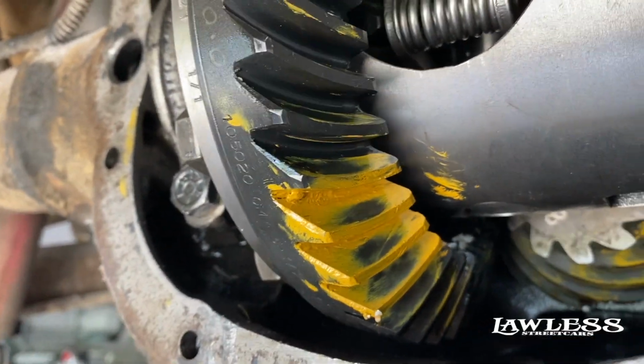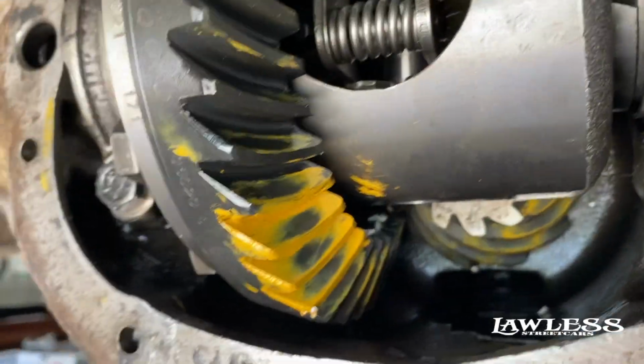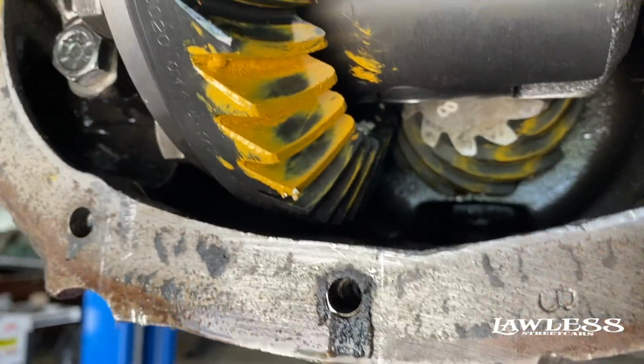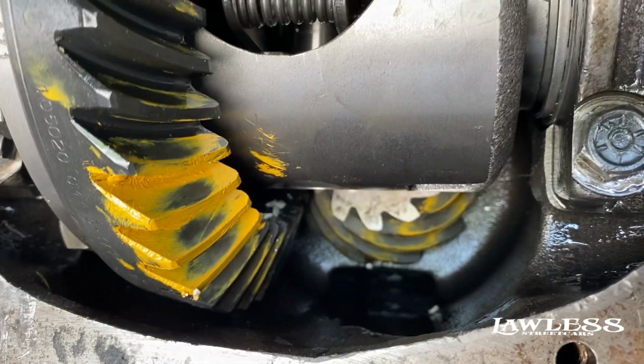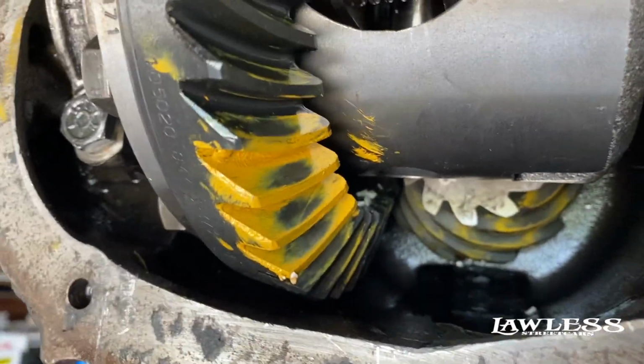I mean, if possible. Sometimes, like a lot of these gears, they'll run them and lap them. This particular gear, I don't really know what brand it is, but they didn't run this gear and lap it, which I don't really like, but it's just kind of part of it. But always try to get your pattern in the middle. Like I said, that's why we use that setup deal.